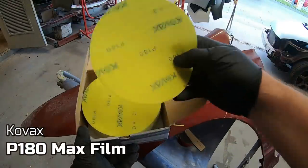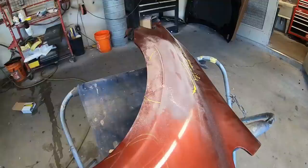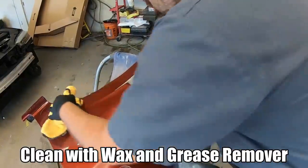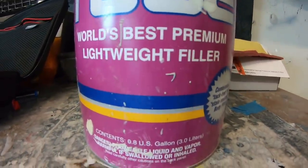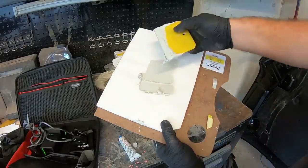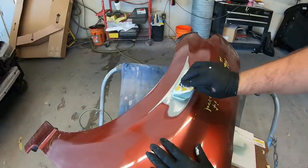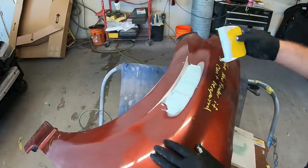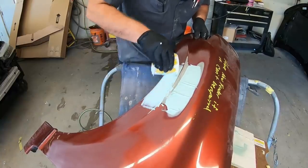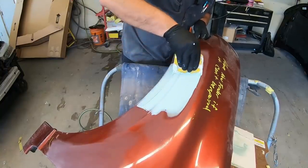We're going to use 180 grit here to take off all the paint down to bare metal. When you're working a bigger dent you're going to want to remove the paint down to bare metal. If it's something small you could just do 180 and then fill it, but if we have some hammering work we want to make sure we do that. We're going to be using a Rage Evercoat filler — using a mixing board, I take my hardener and put a line only halfway the width of the actual body filler as a guide. Get your filler on first and then go long ways with the spreader. I'm putting it on some sanded clear coat here since it's sanded with 180 and we just have a little ripple, but if you have areas with a lot of body work, make sure you take it down to bare metal.